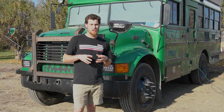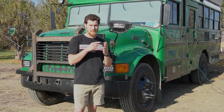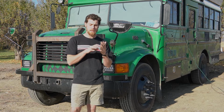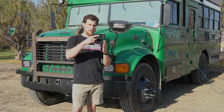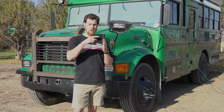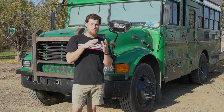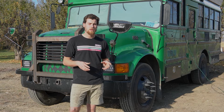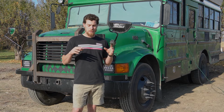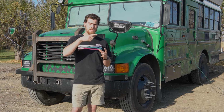Or the way I'm going to do it, because the piece didn't fall in the oil pan, I'm going to leave the oil pan up, I'm going to back that nut off, clean around really well, get all the oil off, and I'm going to take RTV black, so it's for oil, and I'm going to put a bead around where the nut goes, tighten the nut back up, and from what I read, you don't want to over tighten this nut. I didn't see any torque specs, but I'll do the good old forearm torque of not over tightening it. So then I'll tighten it back up with that RTV, and then RTV around it again.